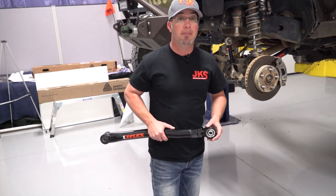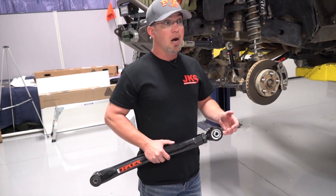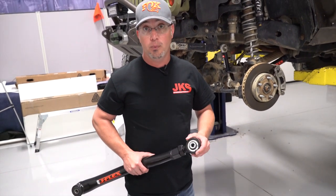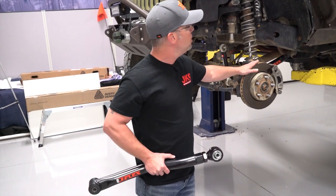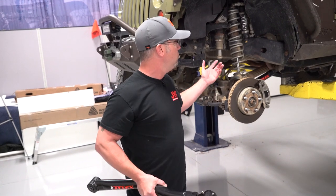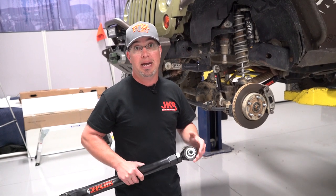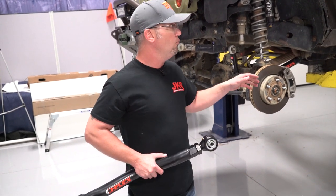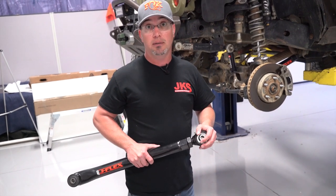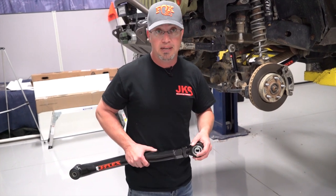Some of the reasons why you might be adjusting control arm lengths: A, to correct caster from a lift kit and affect geometry. Also, some folks like to get a little bit of their wheelbase back. When we lift the Jeep, as you can see this Jeep here fully drooped out, we lose wheelbase. The higher we lift it, the less wheelbase we have — we can extend that back, which is a lot of what we do in rear lower applications. Right now we're focusing on the front lower application, which is where most geometry correction happens and what you'll feel the most driving down the road.